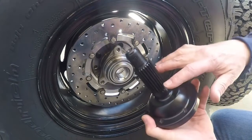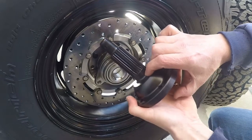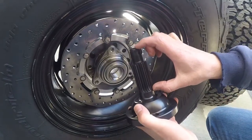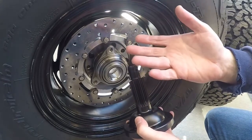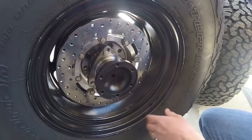If you break this, you're going to lose the ability to drive the wheel, but the wheel is going to stay connected to the suspension. On the Type 1, since the bearings ride on the shaft further inward and this part carries the weight of the vehicle, if this part breaks on a Type 1, your wheel and tire fall off. That's all there is to it. So this is full-floating, which I really like.